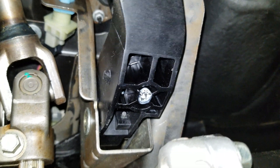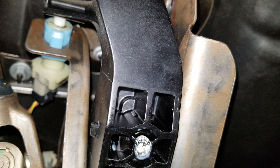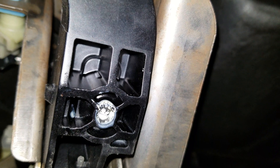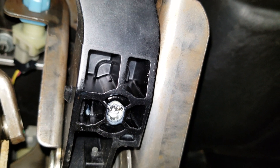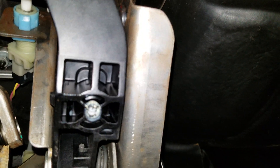So what you want to do to see if you have this piece installed — and you may not even have to worry about this — push the clutch pedal back. Now the bushing that I just stuck in there, it's basically a white piece of plastic, but what it does is it makes it completely smooth for the rubber piece to push against. So it's not going to eat away at the rubber and eventually make it fail and end up pushing right through the pedal because it's grinding metal to plastic.